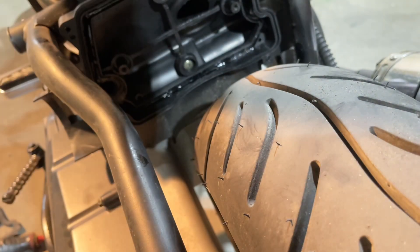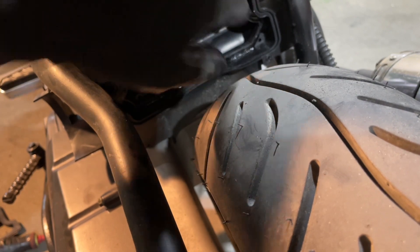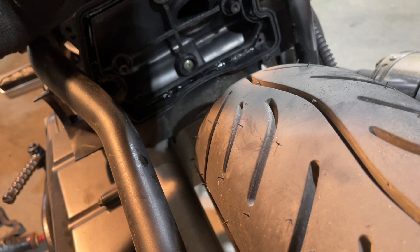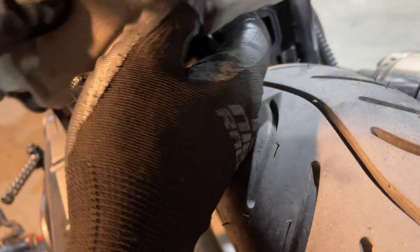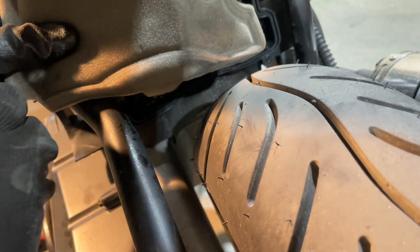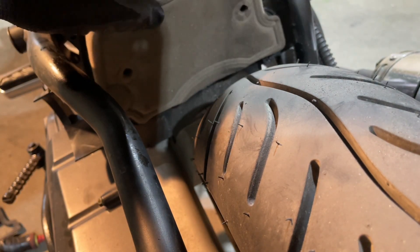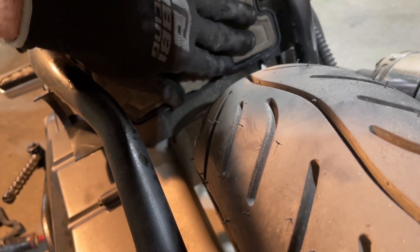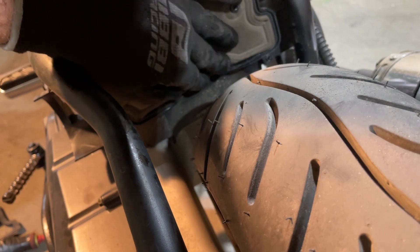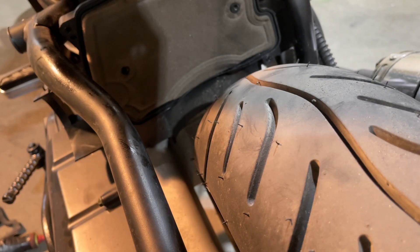And that's your filter right there. It smells pretty gassy. This one's pretty clean — there's no dirt in it at all. It didn't even pick up any debris or dirt. It's very clean inside. So all you would do is clean it in a container of gas, like any sort of Tupperware container, and then once you're done, wring it out and put it back in. When you do this and try to put it back in, it's going to be swollen a little bit and slightly bigger because of the gas. But if you take it out dirty and clean it with gas, you'll see how clean it gets. This one's not very dirty but the bike has hardly any miles on it.